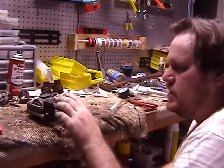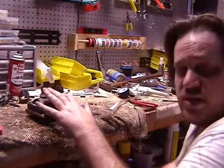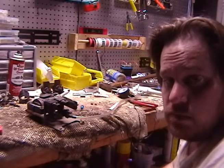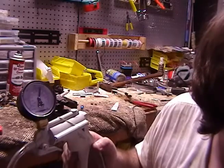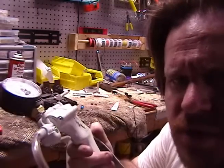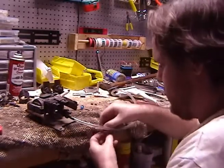I haven't figured out exactly where these go yet, but we're just testing them anyway. These two solenoids divert vacuum pressure - they activate the pathway for the vacuum so it travels to its destination. It's holding at 12 inches of mercury, so that's the first test.